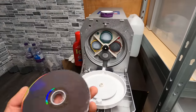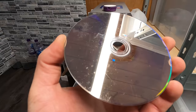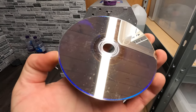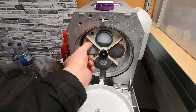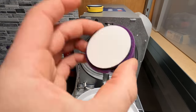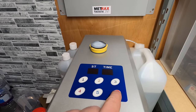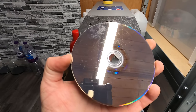I'm also going to clean the case up, get the sticker off, and use a little bit of T-cut to get the scratches out of the case - then I can sell it for top money. This machine also does Blu-ray discs. I've found a Blu-ray with some scratches on it. I think it is harder to get scratches out of Blu-rays, though luckily they tend not to be that badly scratched. In order to use Blu-rays you have to take out the yellow pad and put this violet pad on - I think that's the only one that works with Blu-ray discs.